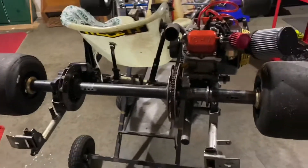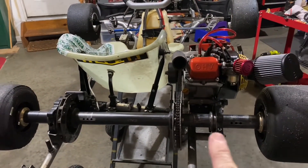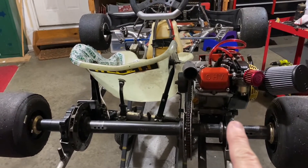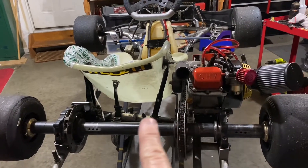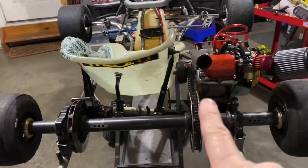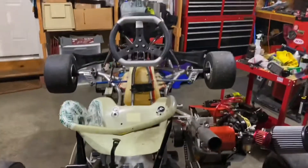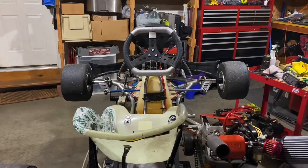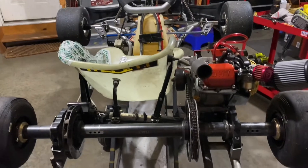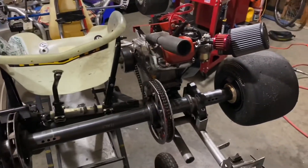Typically in my sprint kart the motor would be offset a little to the side rather than centered on the two rails. Cutting off those supports did help in allowing me to move this motor over. I still have a pretty decent amount of clearance with the seat — I was able to scoot the seat over, and even though it's a little cattywampus and off to the side, when I sat in it and drove it today it didn't really seem weird.